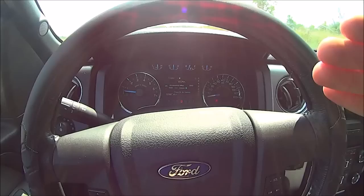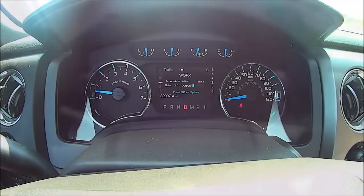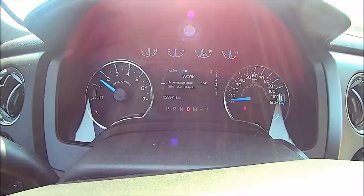Normally you want to go up in half increments, but seeing as this trailer is a 14-foot enclosed, I know the dry weight is about 2,300 pounds and it weighs about 3,000 pounds how I tow it with all my stuff in it, give or take a hundred pounds. So I know gain=2 is not going to do much either.